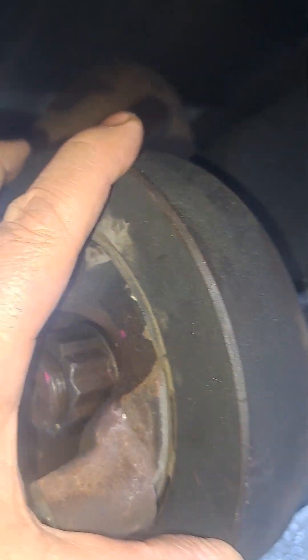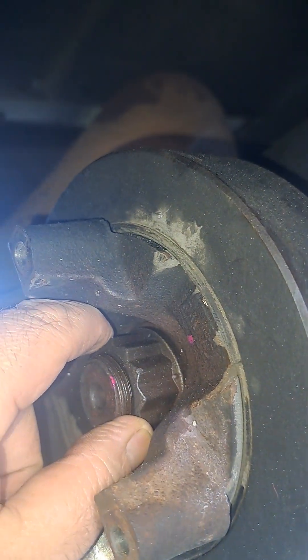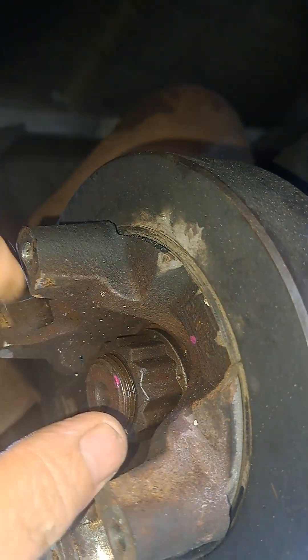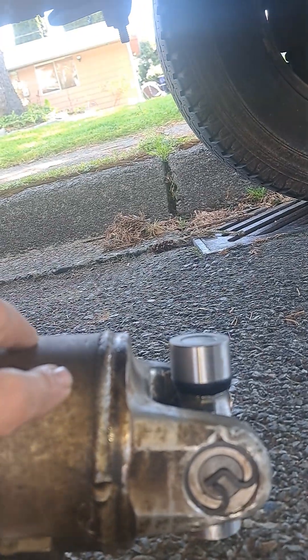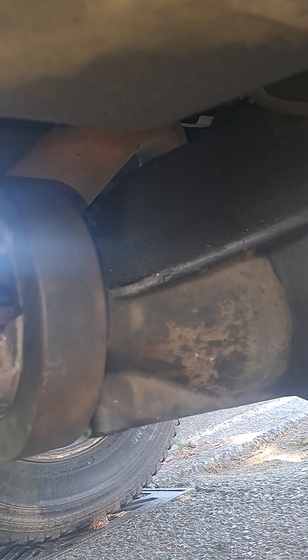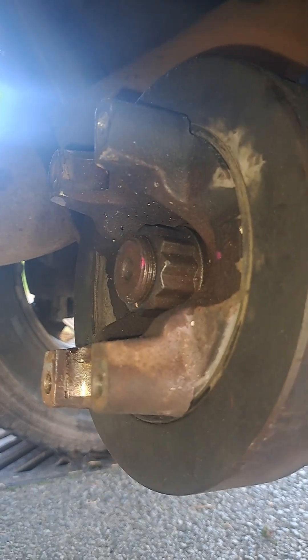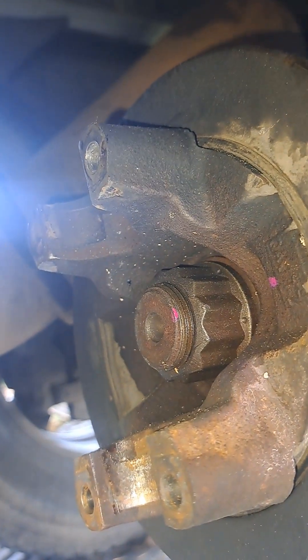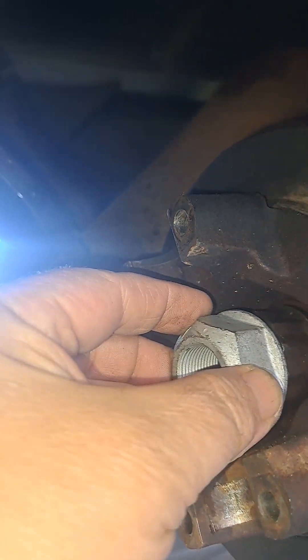I marked it — you can see the match marks so I can put it back exactly where it was. When I was at Chevrolet, they said well maybe they changed this part or the rear end to different gearing, or maybe they changed the driveline for whatever reason. So just for laughs I went and ordered one of these nuts to test and see — it's kind of a telltale. If I buy the nut that secures it from Chevy factory, it should fit on there, and that's going to tell me if this is stock or not.